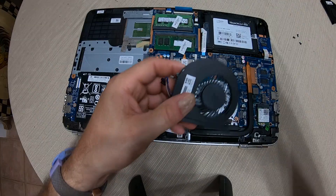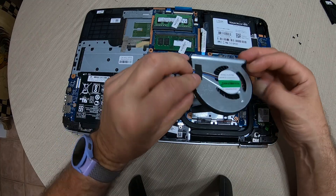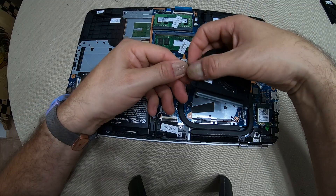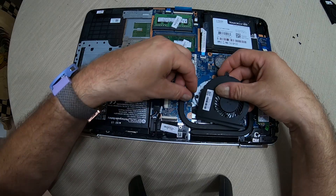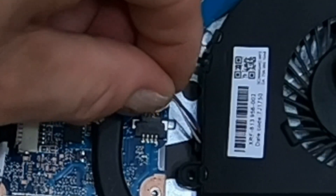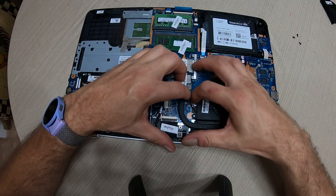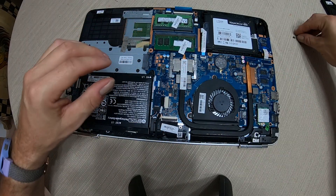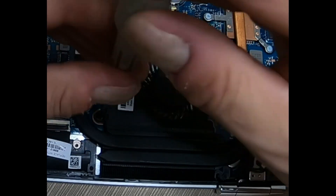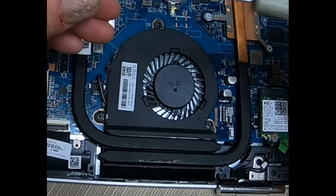The tab that has all the information on it always faces up, and this part always faces down. I see gold, I see slits facing upwards. Just take your time — you don't want to force the tab into the electrical connection or you may end up breaking it. Just work it gently and pop — it's in. Make sure it's good. Now take the three screws and put them in. Don't over-tighten or you'll strip the board.